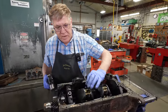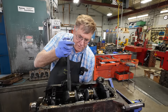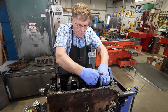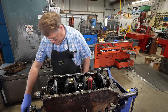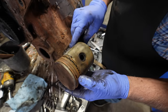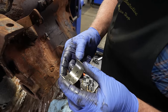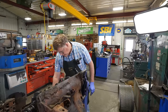A lot of times if I was worried about the crankshaft, I'd put some bolt boots on here to save dinging up the crank, but I know we're going to be grinding this one. Look at how rusty and dry this all is — I can't believe it's so dry. I don't know what they really did to it the last time it was run. But look at this bearing — big chunks missing out of it. It almost looks like it's somewhat melted. Maybe that's why everything's so dry on the top here.